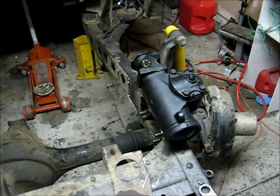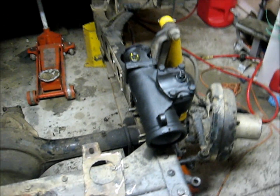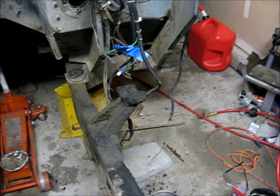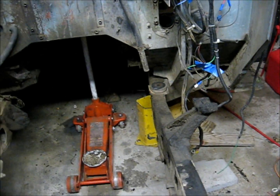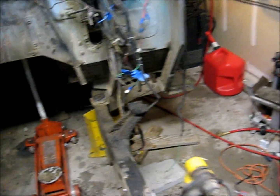In order for the steering to clear, I'm having to put in a different steering box. The old steering box there — that's the whole shaft. It's part of the box on these Land Cruisers, mounted on that pedestal there. And the exhaust manifold didn't clear it — it hit it. It needed to come over another inch to get the motor where it needed to be, so I had to do away with that setup.